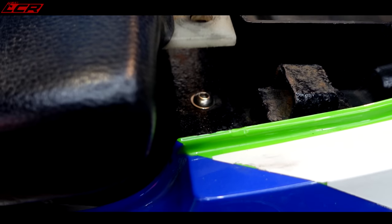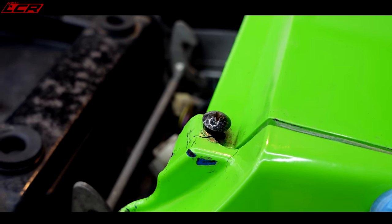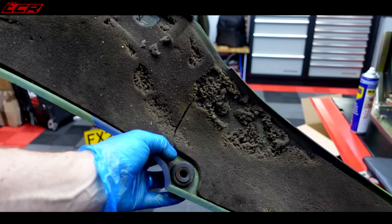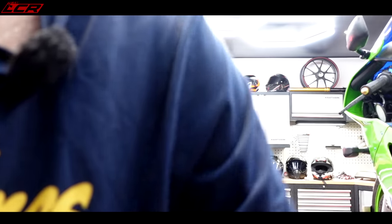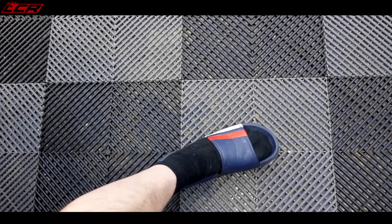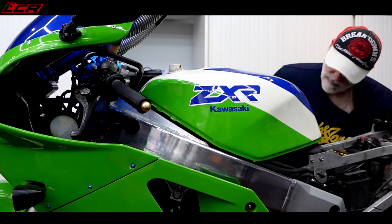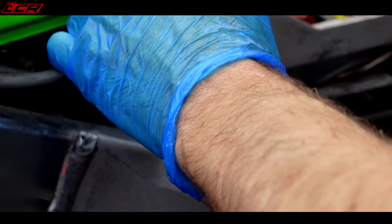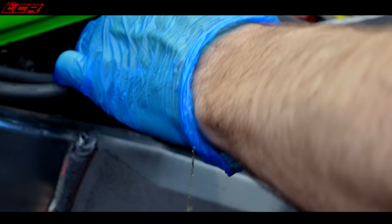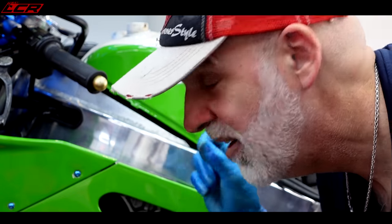The front seat isn't even attached properly — the panel is snapped and not seating at the top, and all the foam on the inside has worn through. The fuel line is going to need replacing; it's very brittle. Some old fuel has come out — that smells nasty. I'm getting lightheaded on the fumes. Now let's lift the tank off and see what disaster I'm facing underneath.